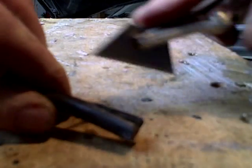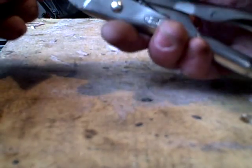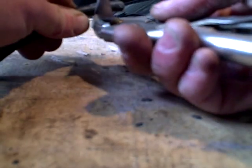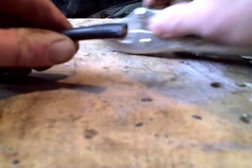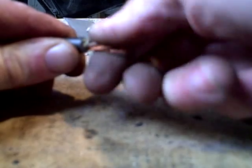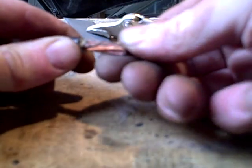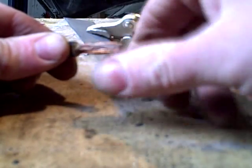I'm cutting around the outside now to get the piece off. I try not to cut all the way through, even though these are fairly heavy conductors and you're not going to lose too many — I would much rather save them all. And there we go. I'll just make sure that we don't have any varnish on here. That looks pretty clean, because you want to get as much conductor in contact with the connector as you can.